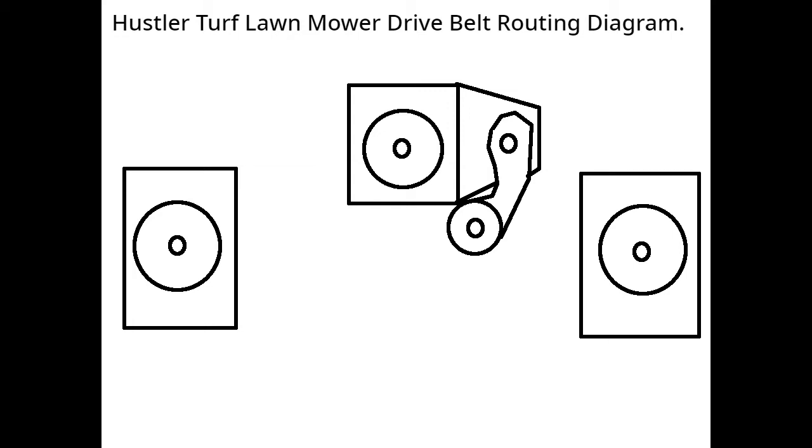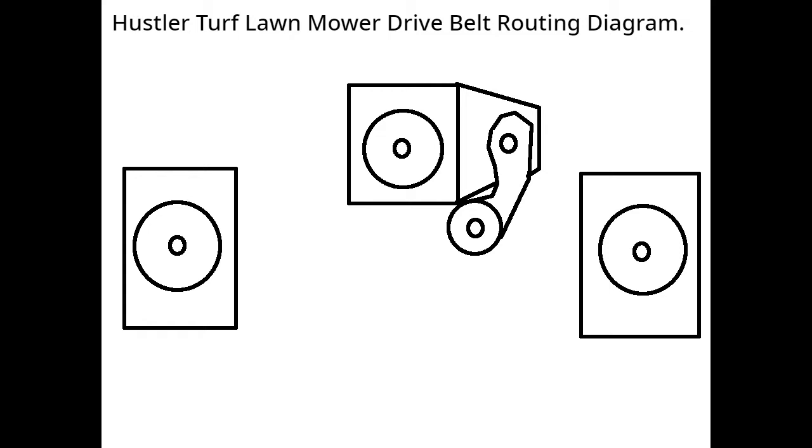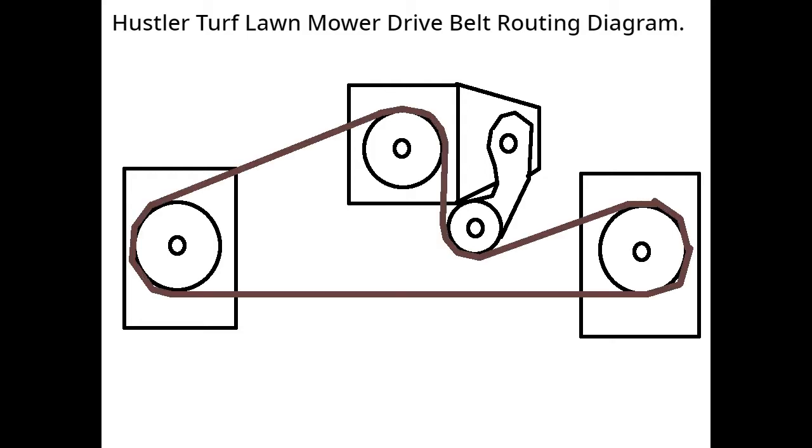Here's your graphic. As you can see, these two are both the drivetrain pulleys — they're attached to the actual parts of the drivetrain. Next you have the tensioner pulley, which is mounted on an arm and can pivot. And next to that we have the actual pulley mounted on the bottom of the engine. On this second graphic the belt is highlighted in brown so you can see how it's routed. It should be pretty easy to get on there if you detension the tensioner pulley by pivoting it.